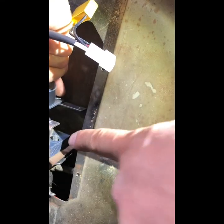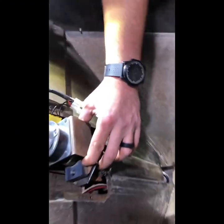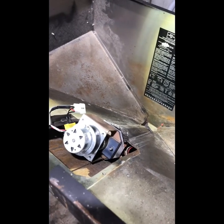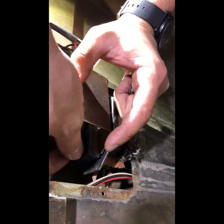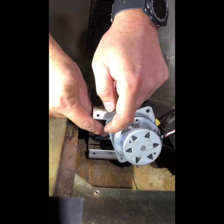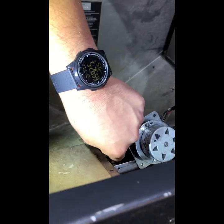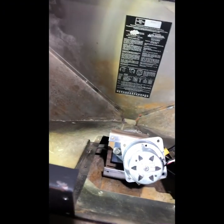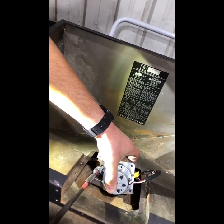Make sure the assembly goes over both bolts. As you turn the motor, you'll gain access to the bolt on the other side. Hand-thread the 11 millimeter nuts first to make sure they're on there and won't fall into the abyss. Spin the motor to access the second bolt, then gently put on both nuts before tightening them down with the impact or ratchet and extension.